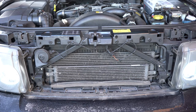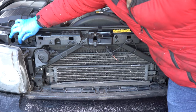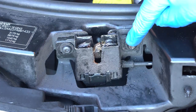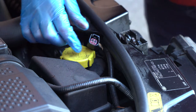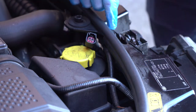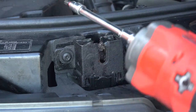With the grill off, we can see a bit more of what's going on. The cable comes in from the cabin along here through this first latch, and then the cable continues to the second latch. On the bottom of the second latch there's a clip, and that is where the microswitch is clipped in. Around the back is a cable that connects to it. So I'm going to disconnect the cable, unbolt this, and lift it up to take a closer look. I've managed to get the connector off — it's just down at the back and just pulls back. So I just need to unbolt the front — there are just two screws here and I'm using a T30 Torx on a bit of an extension just to clear the headlight.